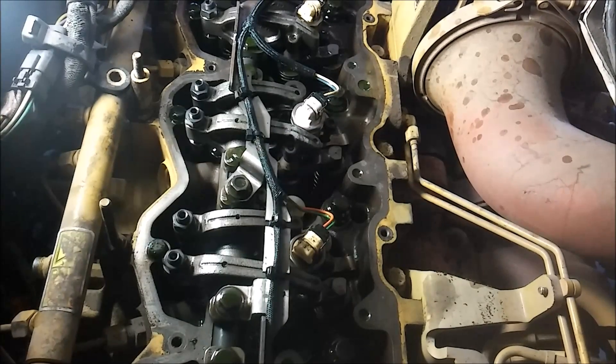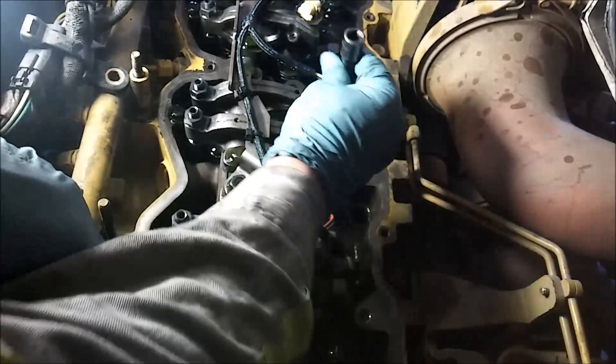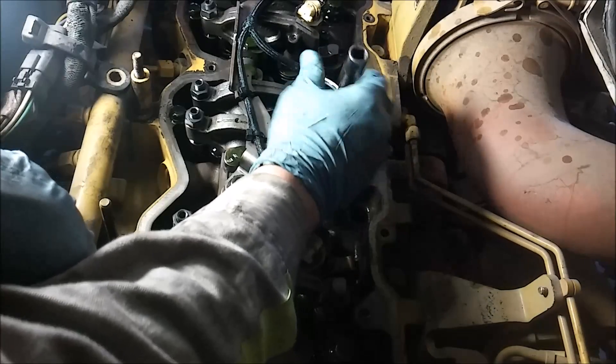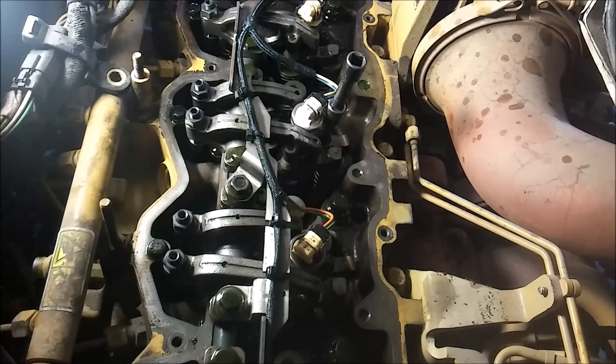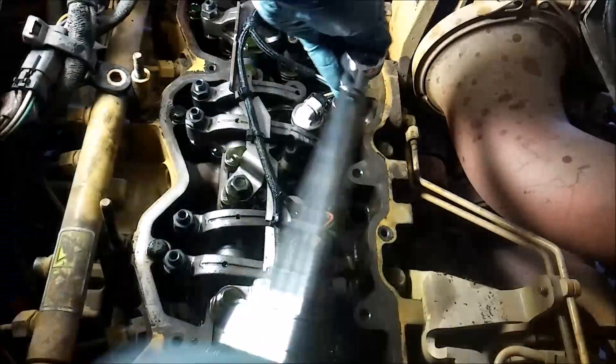We're just going to run it in by hand first and tighten it up. You could use an air ratchet or a really weak impact wrench - you don't want to over torque the bolt. I don't like using heavy impacts. If you're using a lightweight electric one to run it in, that's okay. Then you're going to torque it - these torque to 20 foot pounds on these CAT engines. If you're doing a Cummins or a different manufacturer, you'll have to look up their specific specs. I still look them up every time I do one just in case CAT has updated part number information, torque specs - they're always updating it.